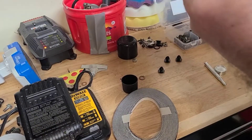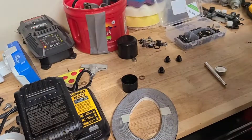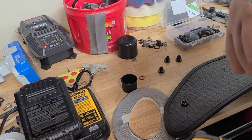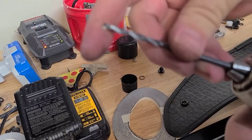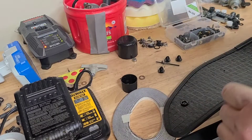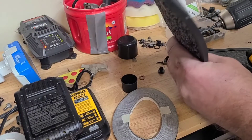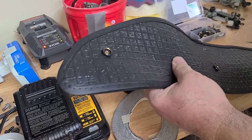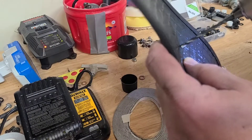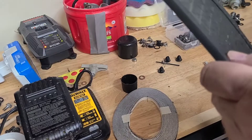Let's show you how to put some of these snaps on. As for the new holes, I had the mat installed and drilled right through the carpet into the plastic on the bike — that's how I made the new holes. Now I'm going to widen them a bit to allow the copper to go through on the snap. On the bike itself, the little screw will self-tap right into that hole I made. I'm just going to open this up slightly, do this to both holes, then add two more snaps for a total of five rather than three. That way it should secure much better. Let's start off with five.